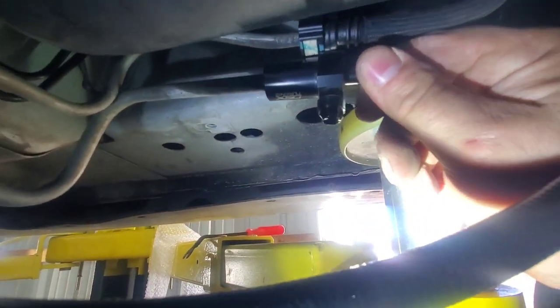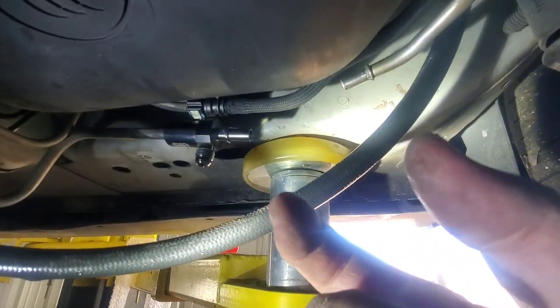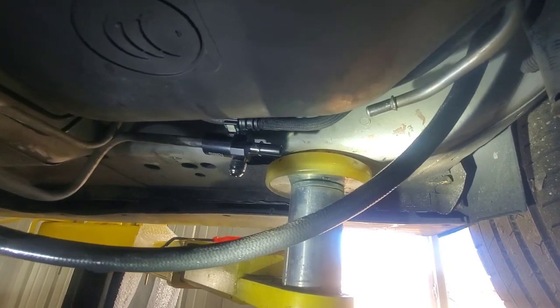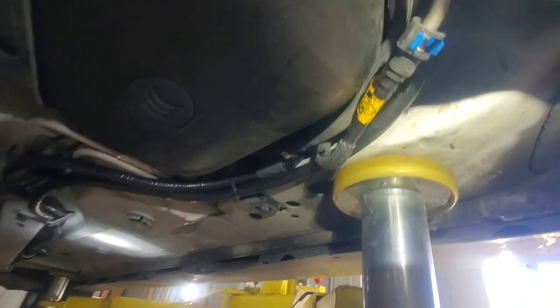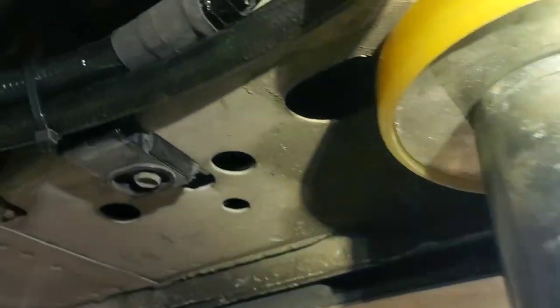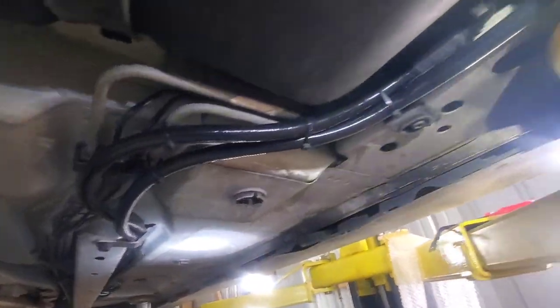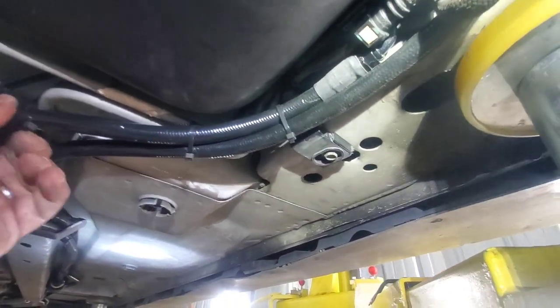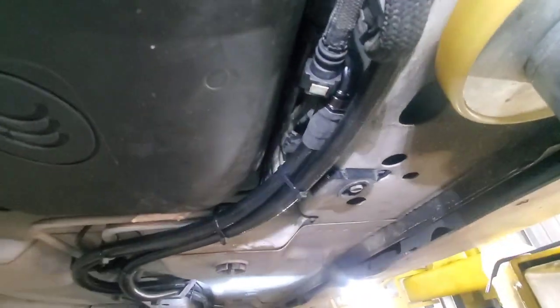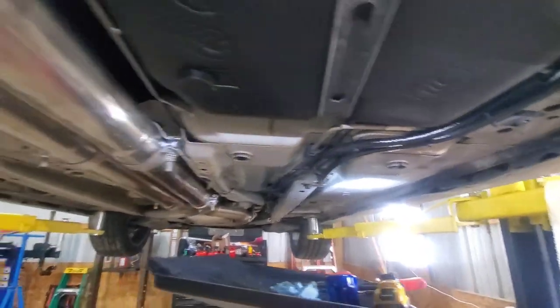Here's the fitting — I just pushed it on right here, and it snapped on good. The other fuel line — the little jumper goes in between these two — and those just snap together. The front one snaps in where you squeeze the sides, and the other one goes in and you push the plastic clip up. Here's where they're installed — the hose reversed, the clip used to be up in the front. There's the 90-degree fitting going up to the front. I got it back in the holder; I took the lock plate off because I don't see a need for it since they snap in pretty good. Everything's pretty tight and snug as far as the hoses go. Looks like I've got plenty of clearance — my exhaust will hit the ground before that will.